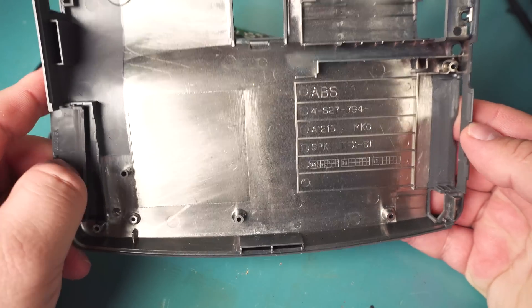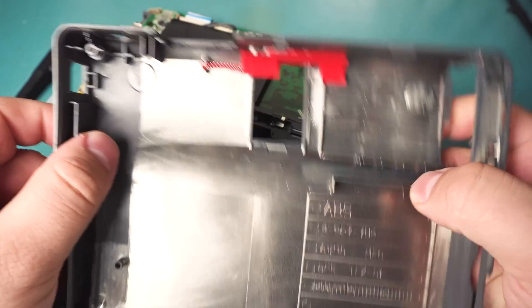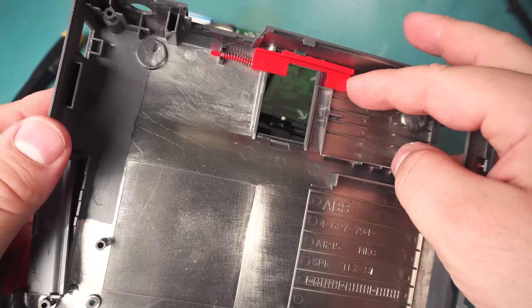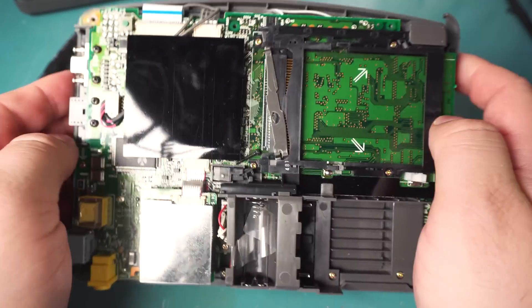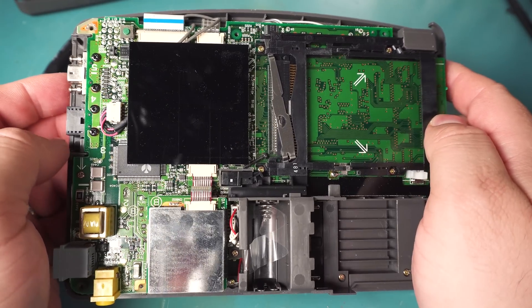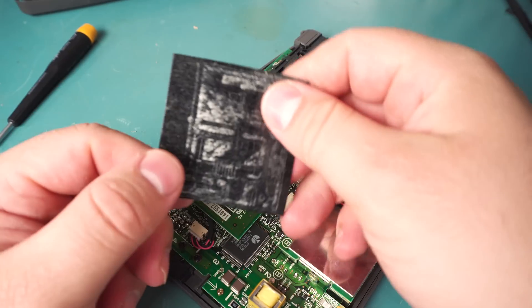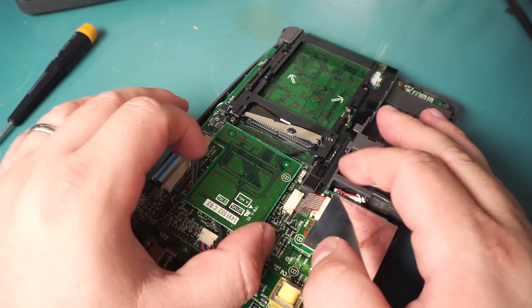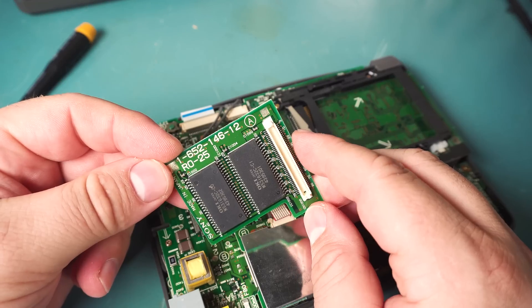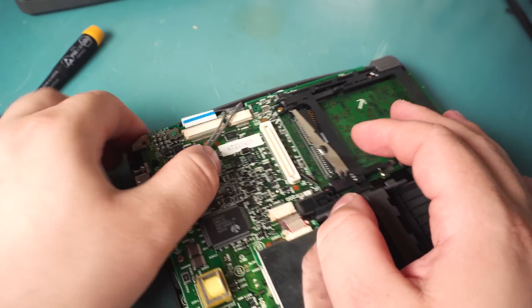The inside just has some shielded ABS plastic, metallized to give a little bit of RF shielding. There's a very simple mechanism for keeping the backup battery safe — as you push the main battery in, it releases the other battery; it's just a sprung piece of plastic. On the inside, this is probably the CPU with a little plastic pad over it, probably just to prevent it from shorting to the metal case. This small board just has the two ROMs for the Magic Cap operating system.